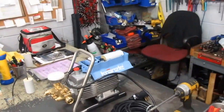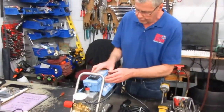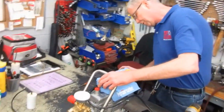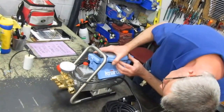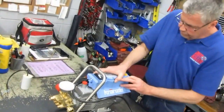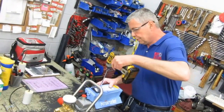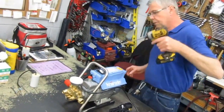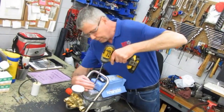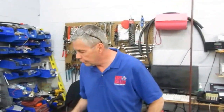Okay, unplug it — safety first. Reverse the process with the cover. Lay it back on. Put the screws in — you can line some of the screws up. Push down, watch your mount lining. Push down. Take the screw gun, run the screw on down, not too tight. And that's all. You just changed the capacitor on a K1622. The end.